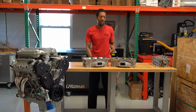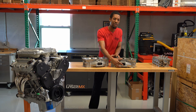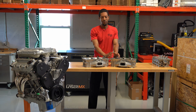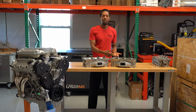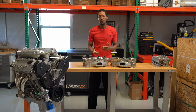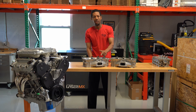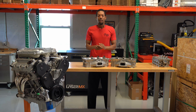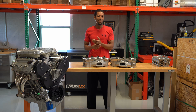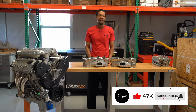We didn't go too big. We've cut the heads open and can see how much material we have, so we know we're not breaking through into the water jackets — because there is water right below this exhaust port. We have to be very careful of how much we remove. There is a limitation, and we also want to make sure we're keeping a strong power curve; we don't want to just open up the port and give you a flat car that only makes peak horsepower. You can see how much smaller the stock port is compared to the ported one, but we were able to get a really strong power curve and also increase peak horsepower. Depending on the 3.5, you'd see peak horsepower around 5,000-something RPMs stock. We're able to get your peak horsepower a little bit higher into the 6,000 RPM area — and that's assuming you're still on stock cams. As always, if you enjoy our J-series content, please like, please subscribe, and I'll see you guys again soon.